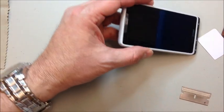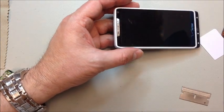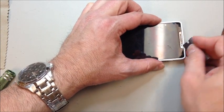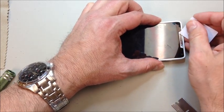This is the easy part. Just be careful — you don't want to damage your clips when you remove it. Then we're going to go ahead and heat up this metallic label at the top that says Motorola on it, because we've got two hidden T5 screws underneath here. If you start prying before you know where these are, you can get into trouble cracking the case.